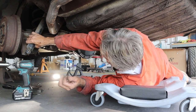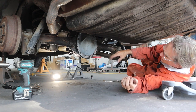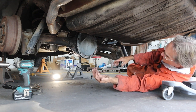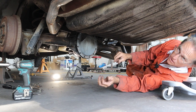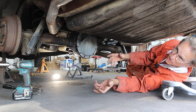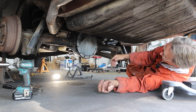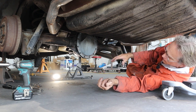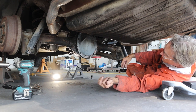All I need to do is get the jack underneath here and put a little weight on it and see if we can get it out. This thing is leaking quite a bit just sitting here. I went to take the pinion nut off — I thought it'd be better to do it with the wheels on the ground just in case the nut was super tight. I put the socket on there and it was loose, actually not even tight. No effort at all to get it loose. They didn't use any Loctite on it to keep that nut from backing off, so it may have backed off causing this leak problem. We'll have to check the bearing and everything once we get this out.